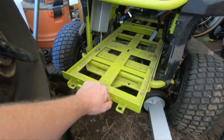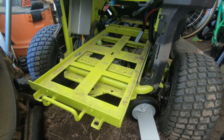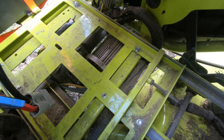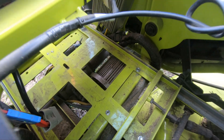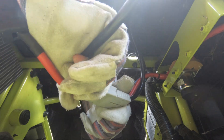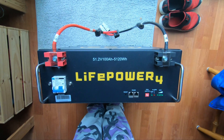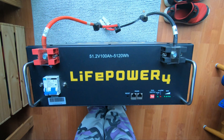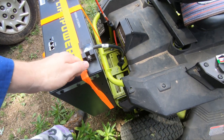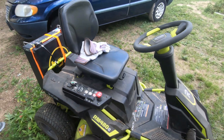What I did was this: you can see I slid the bottom rack that holds the lead acid batteries back some, and then I used some heavy duty self-tapping screws and screwed it all into place, and then set the server rack battery on the back and strapped it down with tie downs. It's on there pretty snug. I used the original Anderson plug and wiring and also extended those with some of the wiring that Signature Solar included with the server rack battery. I put some electrical tape around the connections of the wires too. That's the best I could come up with for just slapping it together — a couple hours chucking some stuff together with what I already had. I was channeling MacGyver.